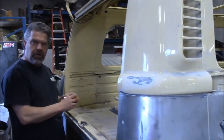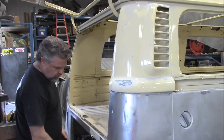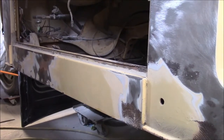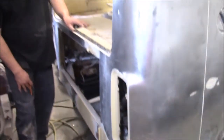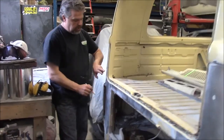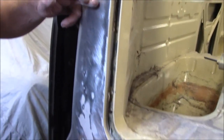We'll expose any rust-through areas and work on those. We also removed the rubber weather stripping that goes around the opening and around the engine lid opening. We've ordered the rear panel that goes along here — it's rusted through, with numerous pinholes that body filler has kind of hidden. This is really common on the Westies, so we have a correct replacement panel for here. We've also ordered the battery tray, which is heavily corroded — in an earlier video there was a hunk of plywood laid in there to hold the battery. There's also excessive body damage where this whole section was punched in and distorted, and there was approximately a half inch of body filler from about this area all the way to the taillight.